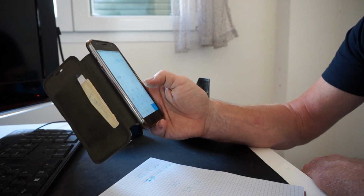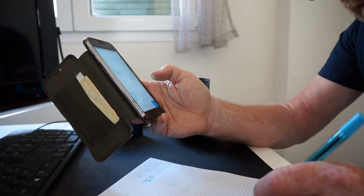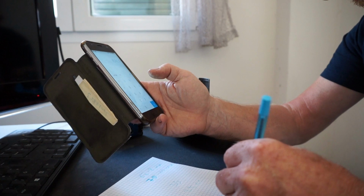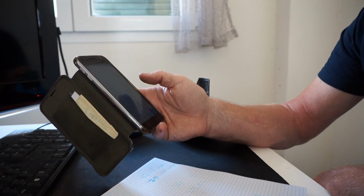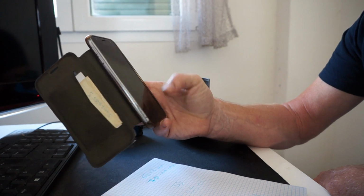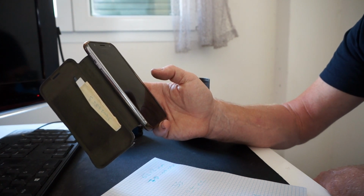So that is then shared by 28 cc's, and it gives us 8.24 compression ratio to 1. That is our compression ratio for a swept compression ratio, not corrected compression ratio. What we want to know is the swept compression ratio, 8.24 to 1. And considering we're on a touring engine, that's quite a nice compression ratio. I'm not going to take any extra volume out of the head. We're sweet, 8.2.